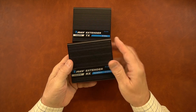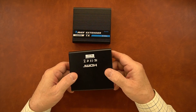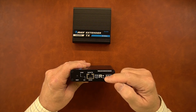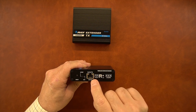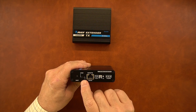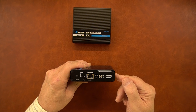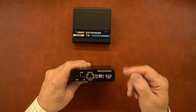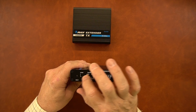The receiver looks very similar — heat sinks on the top and sides, the same mounting holes, and the same reset button and power indicator on one end. In the center you have your network connection, the cable connecting these two modules together. To the left of that is the S/PDIF or ARC selector, which determines where the audio is going to come from — this unit can provide external audio either through the HDMI connection or through the optical connection, and that switch allows you to select between the two.